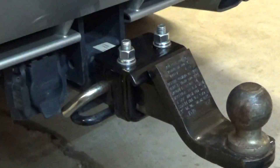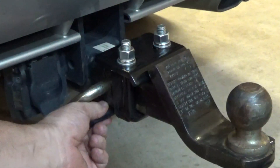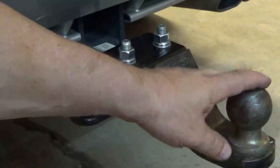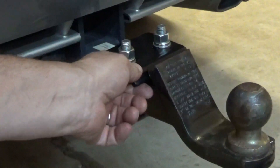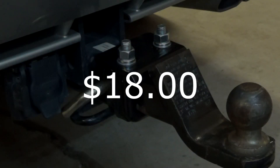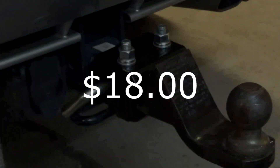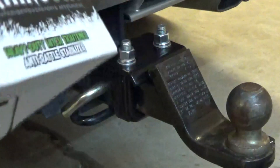Installing it upside down will also move the plate out of the way of my safety chain holder. My safety chains hook on here, and this plate will be out of the way so that if the trailer comes off the hitch and the safety chains go tight, they won't be interfered with by the anti-rattle clip. These are available anywhere from $11 to $25 — I chose Rhino USA after doing some homework and research, and they're not a sponsor.